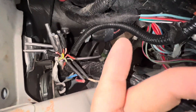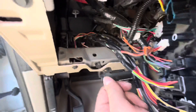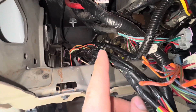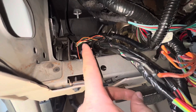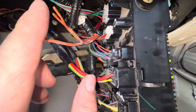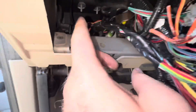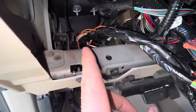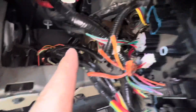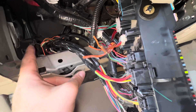Once you find that wire, you need to find the wire for my case to switch to the auxiliary switch. Now I want to note for the auxiliary switch wire — I actually got this wrong and had to undo everything I just did because I got it mixed up. You're looking for an orange with light blue wire. You have some back here which is orange with light blue, and you also have some that's going to be pretty close to the back of your fuse panel. The wire you want is specifically this one — the orange with light blue closer to the fuse panel. The wire back there, even though it's also orange with light blue, is the firewall pass-through because these trucks have the connection point inside the engine compartment. So you do not want that wire. You want this wire right here, closer to the fuse panel. That other one looks really tempting, it's really close — don't do it, it doesn't do anything.